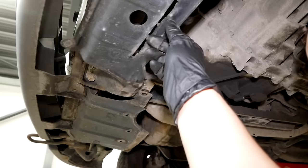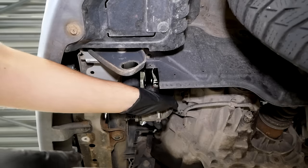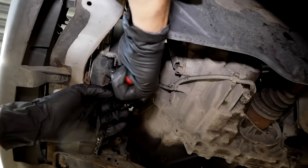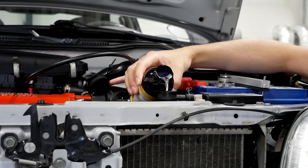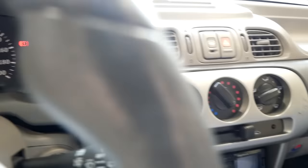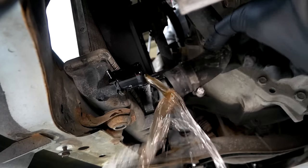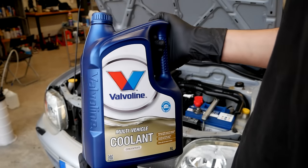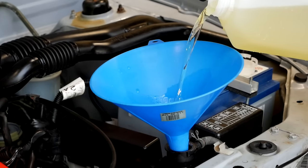In order to gain access to the lower radiator hose, I need to remove this plastic shield. The instructions say to empty out as much as you can from the cooling system, replace that with some demineralized water, and then fill it up with the coolant flush according to your coolant capacity. Then you just run the engine to operating temperature and set the fan to full heat so that the coolant circulates everywhere. I repeated this process with demineralized water four times to get rid of all of the old coolant and the coolant flush. Lastly, I filled it up with a 50-50 mix of some Valvoline coolant.